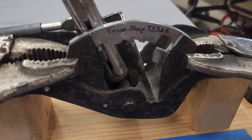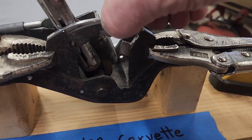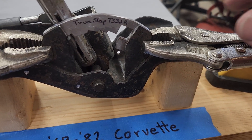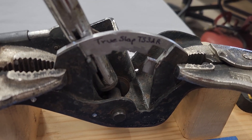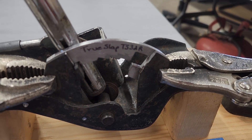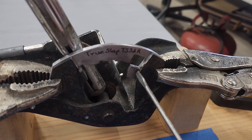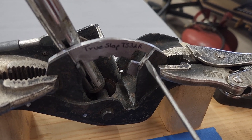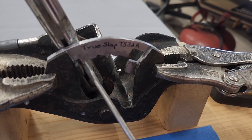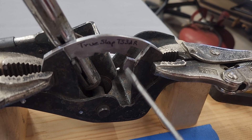Just like the other two — the three speed and four speed normal pattern — you have to cut away part of the metal. Here's the piece I cut off of the original detent. These are heat treated from the factory. The original detent plate is so hard you won't be able to cut it with a hacksaw or anything — you'll have to use a cutoff wheel. A little eighth-inch cutoff wheel takes care of it real quick. You can see this surface in the back here. You want to make sure this is the original surface — I didn't do anything with it, the color hasn't changed. I just made this surface flush with the bottom so when your pawl comes back, it goes all the way back far enough for the transmission to be solidly in third gear with the reverse pattern.